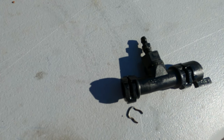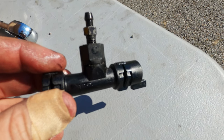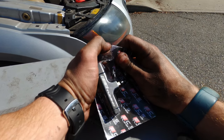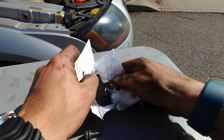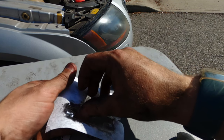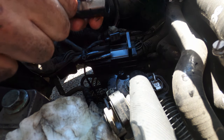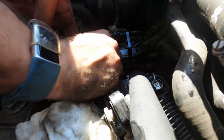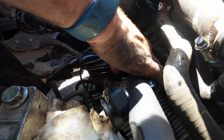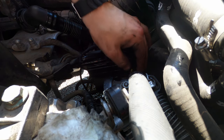Now that the piece is out of the car, we can get a better look at it. Both of the clips were broken as I removed them, so those could have definitely been causing the leak. Either way, the billet piece is definitely going to be an upgrade. The ECS kit comes with replacement O-rings, but that is where this can get just a little bit confusing. It comes with two standard O-rings, but remember this kit is designed for multiple generations of these transmissions. If you have a Mark V or newer based car, just use the O-rings it supplies. But if you have a Mark IV based car like mine, you're going to need to reuse a different style of O-ring that comes on the car. The transmission side can use the standard O-ring, but for the other side you need the original style — otherwise it's not going to seal and it's going to get everywhere.